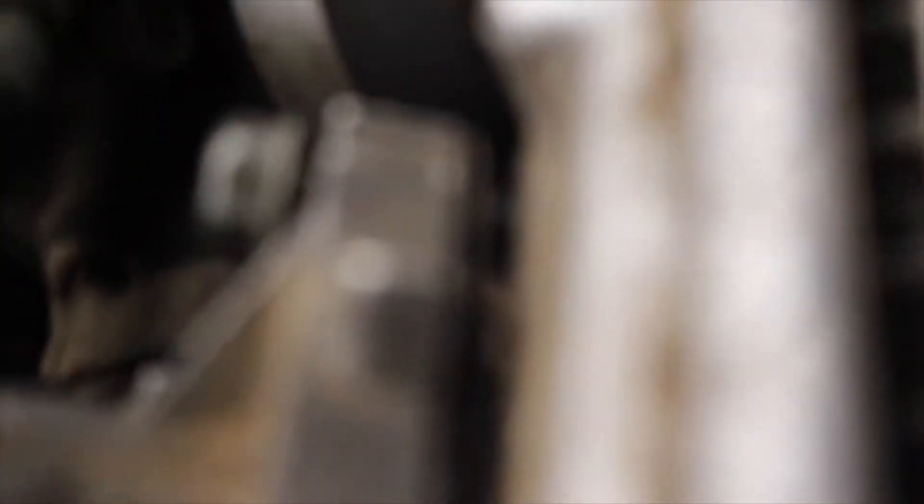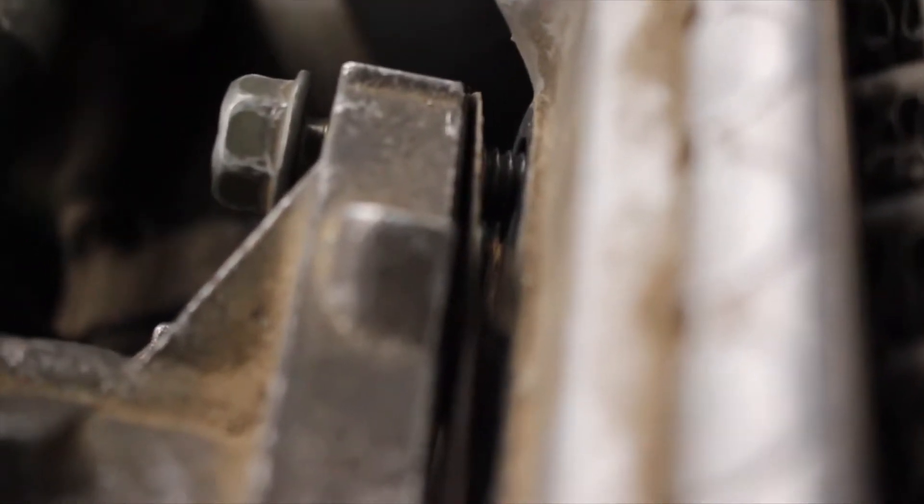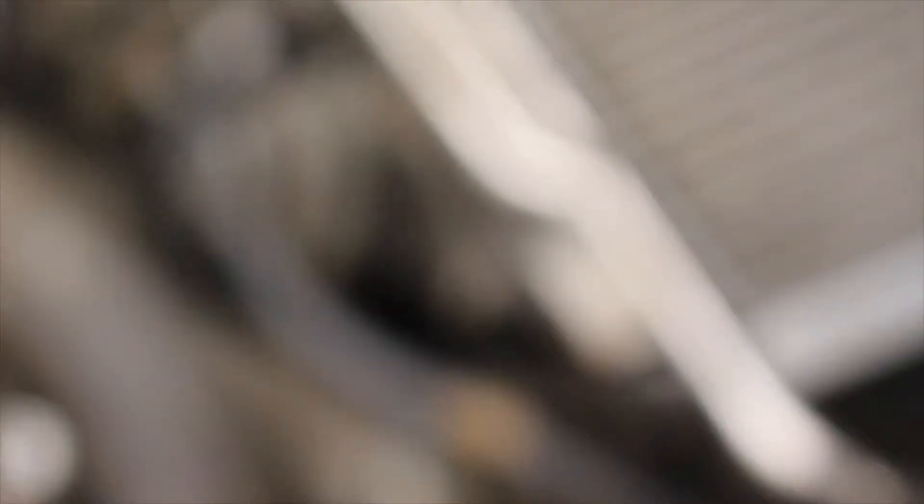So I just popped this guy off. Here's the gasket — that's what that looks like. And then there's the block-off plate, this is what it looks like. I usually like to shimmy this thing in — you really don't need the clip ring, but it helps. So you have the gasket over the bolt, with the bolt partially started in, as well as on the other side. So when you tighten them down, they go in evenly. Alright, everything is put together and we are ready to go.